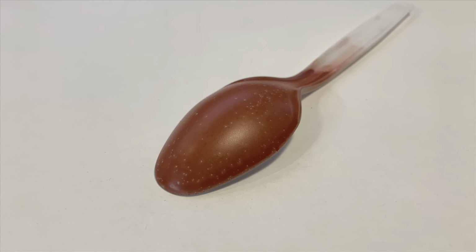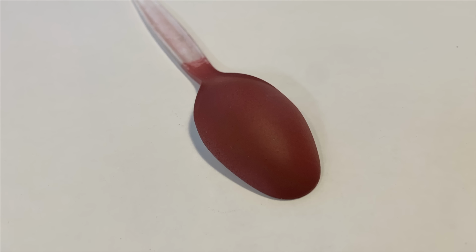This was a problem that I had last week, and it's a problem I've had forever, and that's these little fisheye pinholes. And this is not over bare plastic, this is over primer. So what the heck? And a lot of people commented, this is because you're overly thinning the mixture. And here's a somewhat heavier mixture, and you can see it still has some of those little fish eyes. Again, watch last week's video and this will all make sense.